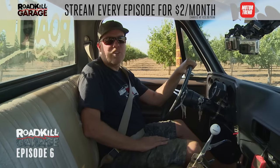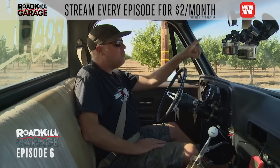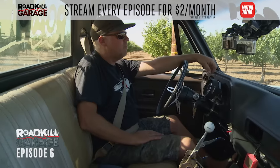This is the nebulous theory that brought us all here today — we're going to find out if I can do a longer distance burnout with 3.70-to-1 rear gears than with 5.13s. With more wheel speed, the engine won't be gaining RPM as fast, so I should be able to go farther — past where Dulcich is standing, which marks the end of my burnout with the 5.13s, almost phone-pole to phone-pole. I need him out of the way because this could get ugly.